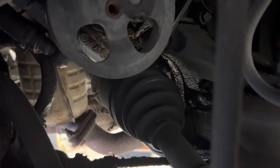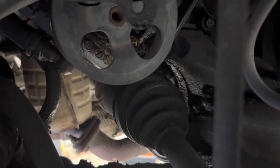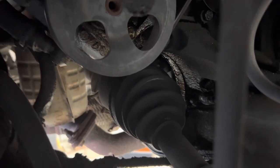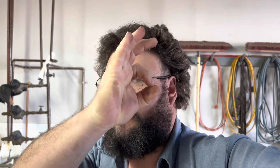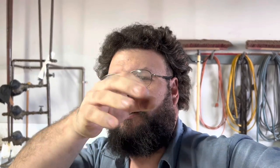Let's see if I can rotate it. There, you can see it moving up and down. What we got is it's got three joints in there — a tripod type looking thing. Each one of them has got a ring on the end of it, and one of them is blown apart.